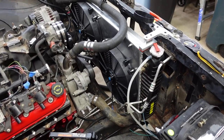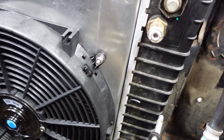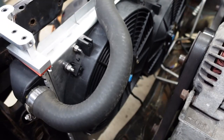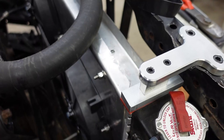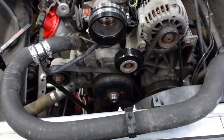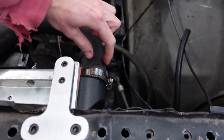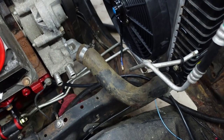I neglected the camera a little bit the past couple days but we got a lot done — the entire coolant loop is done. For the fans and fan shroud I used quarter-twenty bolts and found some nice plastic brackets in the hardware bag, so I used those instead of drilling holes. Each fan has four bolts in each corner holding the fans to the shroud, and then the shroud has six bolts — three on top and three on bottom — holding the shroud to the radiator. For the shroud bolts I used brake tubing with a quarter-inch ID to make spacers so the shroud sits five-eighths of an inch away from the radiator. For the hoses I used the stock hoses off the truck I pulled the motor from — the stock upper hose runs over and I cut about two inches off and stretched it with heat, and for the bottom one I cut about half of it off to get a nice perfect angle.